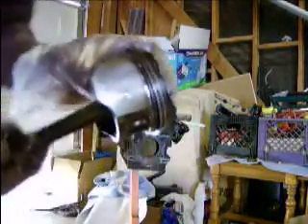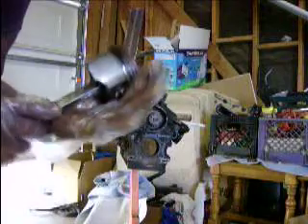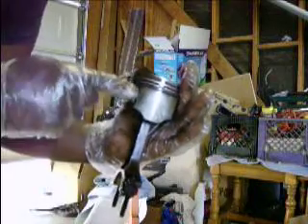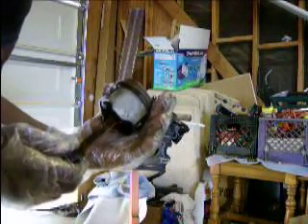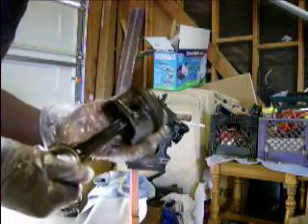Can you see where it's kind of rubbing on the sidewall right there a little bit? But for the most part, that's a lot better than what I assumed. This is from hi-revs — you can see how it's all dark here and kind of light here; that's from rubbing against the cylinder wall. These cars don't like hi-revs; they like to stay around 6,500 RPM tops. I constantly wrapped the piss out of mine and it didn't really complain at all either.